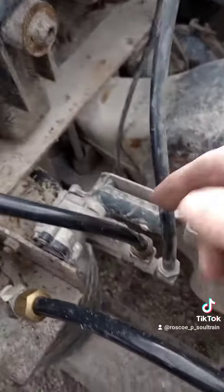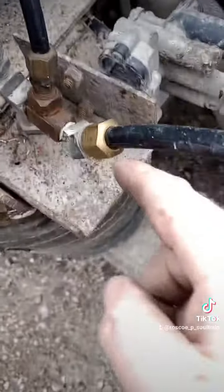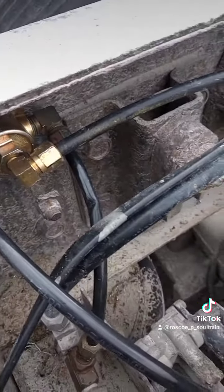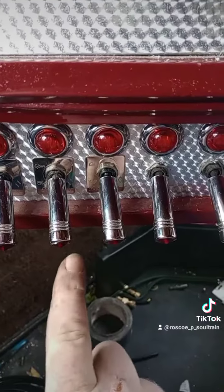Supply air in, then we have air to the suspension through the pilot valve, back out of the pilot valve to the suspension, to the left side and right side. And this is the line that we commandeered to run the pilot valve — that goes through all these fancy new fittings I just installed, to the switch, conveniently labeled dump valve.